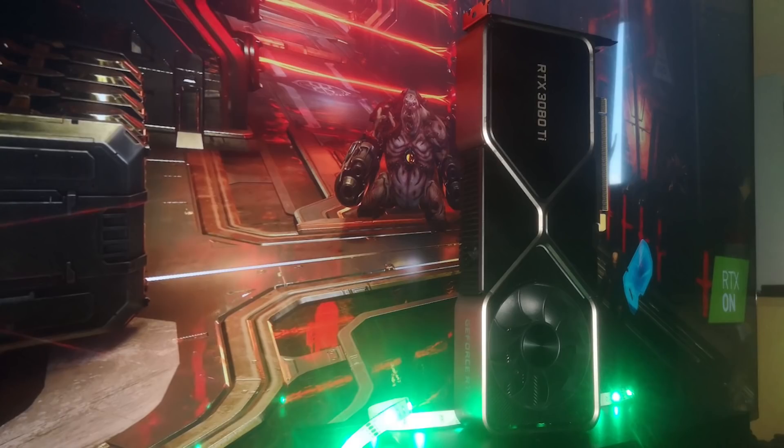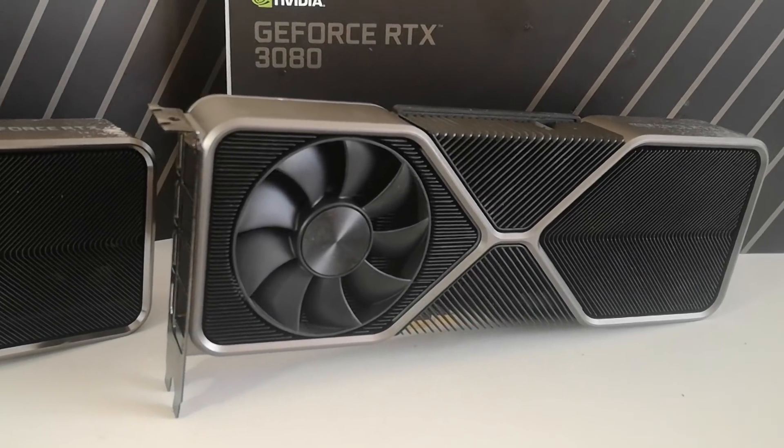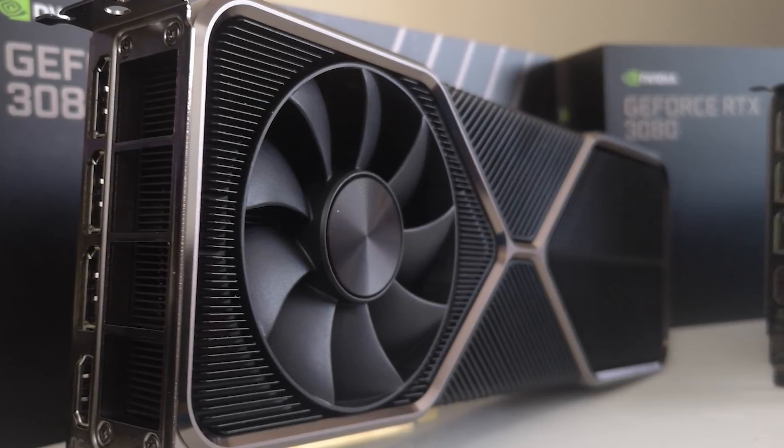On paper, this card should be very close in performance to the RTX 3090. But there's another question: what about the mining limitation? Did it get nerfed? Well, the answer for the Founders Edition card is yes, with some caveats. I did some quick tests by signing up to NiceHash — literally the first time I've ever used it — and I found the hash rate was definitely halved, as you would expect from an LHR card. So if you're mining Ethereum, the RTX 3080 Ti is probably not for you, at least with stock and standard configurations. So the rumour of FE cards being non-hash-rate limited is not true.